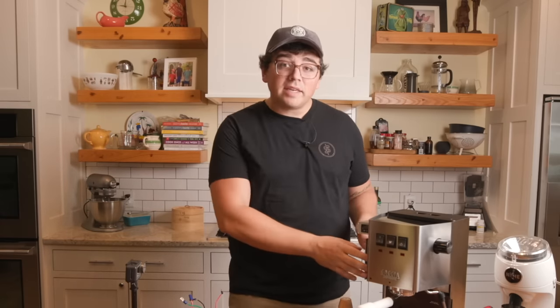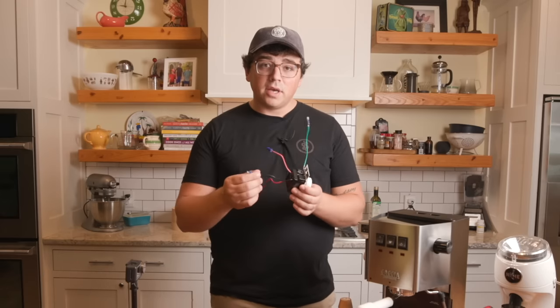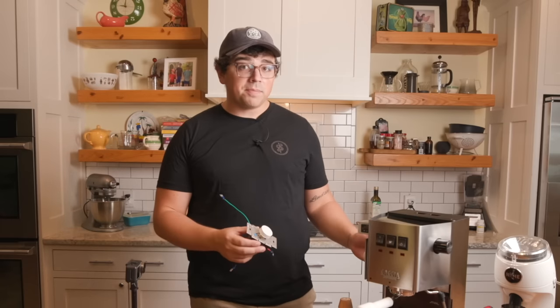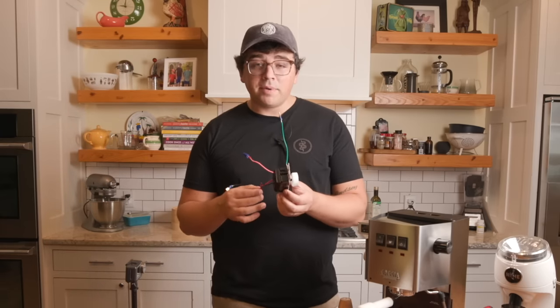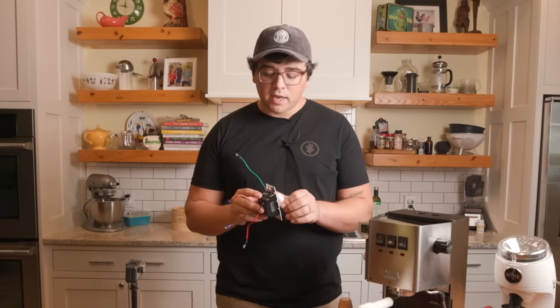It is important if you're doing the dimmer modification that you get a really cheap dimmer that is not made for LED. If you're looking at dimmers and they're over $10, don't get it. I made that mistake. This is a $30 dimmer that has the ability to be a three-way. You want a one-way, a single pole, something that's $5, $7, $8. This one was $6 after tax, okay? This one was $27.99, and I bought it because I just wanted something, and the Lowe's was out and I just bought it.